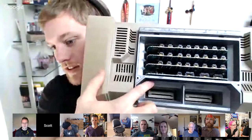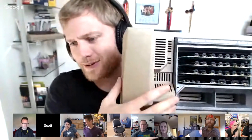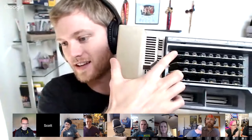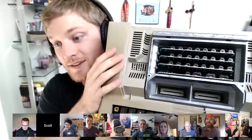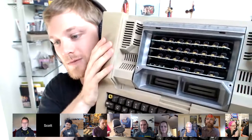The first card here is the OS. It's labeled OS. I think it's Atari OS or something, I don't actually know what OS it is. And then the three cards next to it are all 16K RAM slots, so you can count each bit. I was looking at them and they're all DIP socketed chips. So I'm going to have to pull them out, make sure they're sitting there, and use Philby's trick to see if any of them get hot when they're powered up.